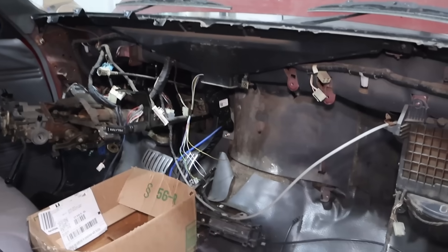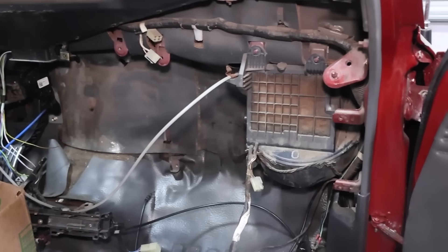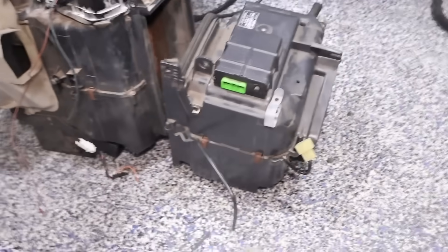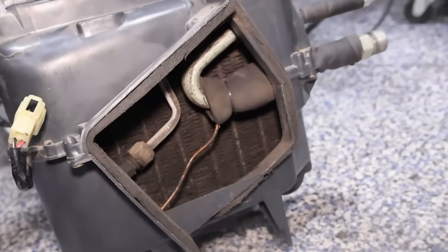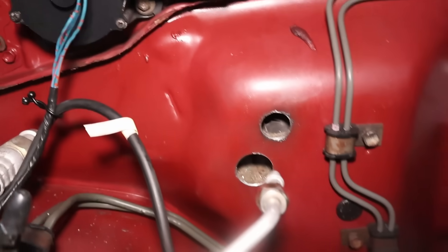So we're working on a Toyota here. Obviously we've got the whole crash bar and dash removed, the HVAC removed. There's the blower fan and blend door, and we've removed all that because we are adding air conditioning to this project — this truck did not come with air conditioning. What I did was buy a kit, and this intermediate pipe gets replaced with the evaporator core. The evaporator core was very dirty — completely clogged — so we cleaned it. I've also drilled holes in the firewall to get the AC lines through, and I've installed the condenser.